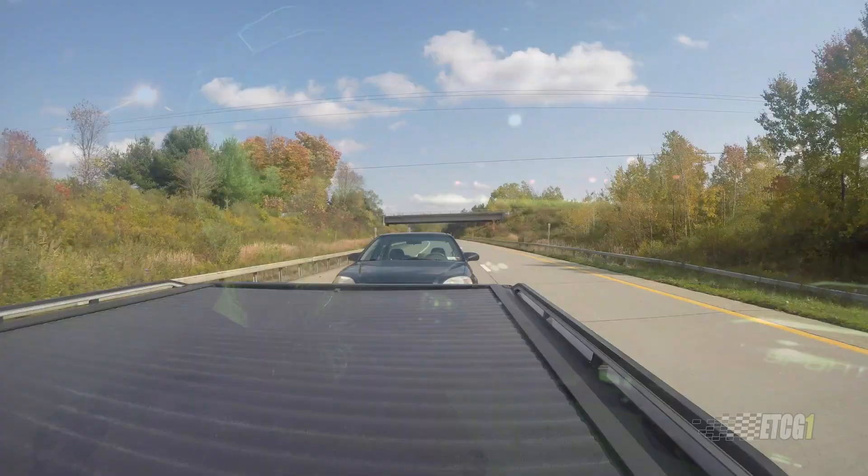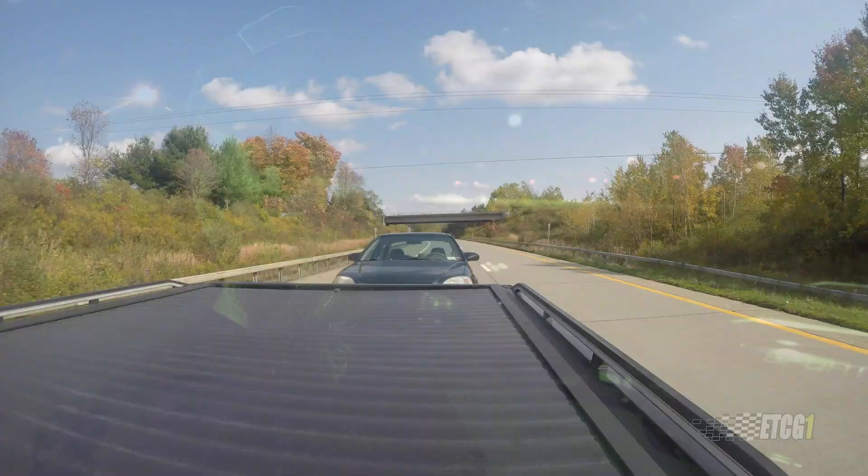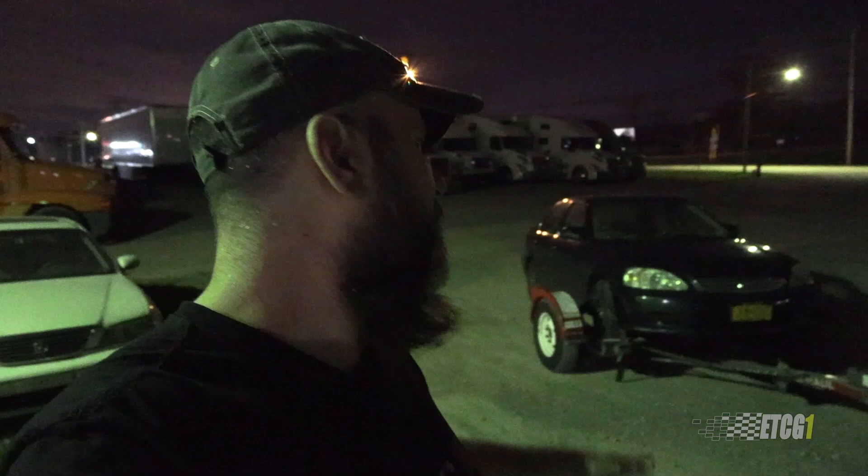Update viewers: I just got done doing about 900 miles of towing with the truck with the new airbags. I had a car dolly with the Civic. I took the TL with me up to New York to give to my son while I work on this one. The TL is heavier by about 1200 pounds — I could feel that one back there. The Civic is like there's nothing back there until you hit the brakes. When towing with car dollies, your brakes are doing most of the work. There's a surge brake on them, but that's usually only when you really spike the brakes. Coming down a couple of hills I could really smell my brakes because I was behind somebody going slower. But the airbags — flawless. Truck was flawless. Truck with car dolly and Civic, no problem at all.